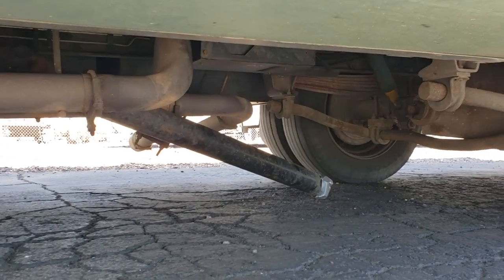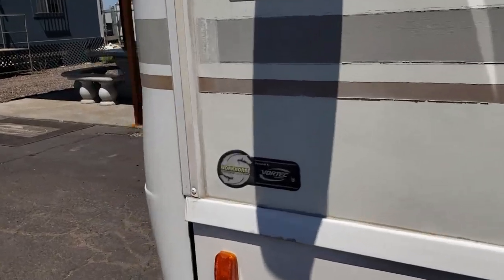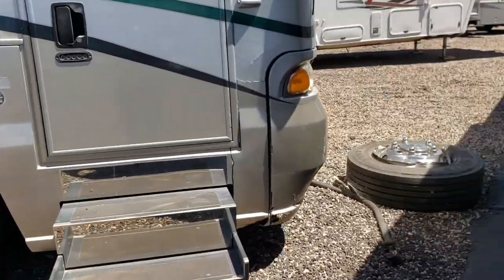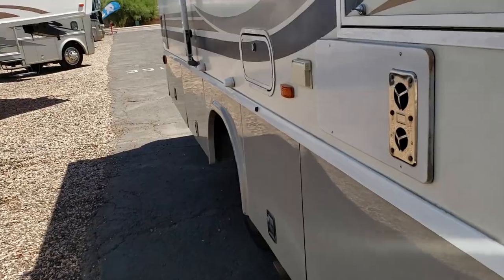The tow truck driver couldn't hook it back up because this is a Workhorse chassis. And on a Workhorse chassis, the park brake is actually located on the drive shaft. Now, because the ignition switch has problems, we can't get the park brake, the auto park, to disengage. So first things first, I have to put in an ignition switch and then put a drive shaft on this so I can get it into the bay and start doing the roof. And then we'll do a quick tour before I tear this roof apart. So hopefully it shouldn't take too long.